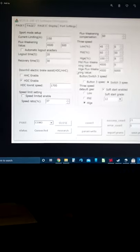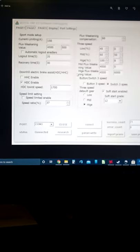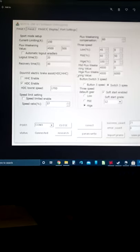But the base voltage controller is rated at 50 amp, which is complete garbage. Like I was saying before, the lead acid batteries are rated at 40 amp, and they've got a fuse in line. So there's no way the controller that comes with it could actually do 50 amp. It's impossible, not without blowing that fuse. And also the controller that comes with it is modified sine wave. It's not pure sine wave. So that does make the motor have a little bit of a groaning noise to it. It's not as clean. The pure sine wave controllers, that's the one where you'll get the best performance out of them. Most of them are regenerative braking. And the motor will actually run cooler as well, as long as it's set up correct.